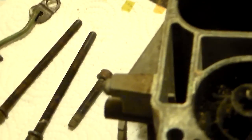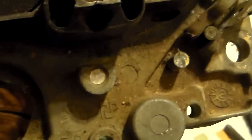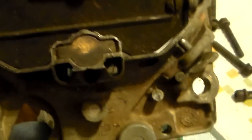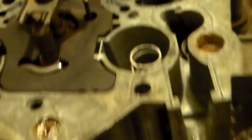Look on the air horn and peek in here - it's kind of hard to see but you have a spot right there where that's been touching. On the outside of where that's at, there's a plug - that's the top of where that square adjustment is. So you can access these from the outside of the car without having to pull the air horn off to adjust those. GM never wanted you to and Rochester said you should never have to, but you can access those by taking those plugs out - that's lean stop and that's rich stop.